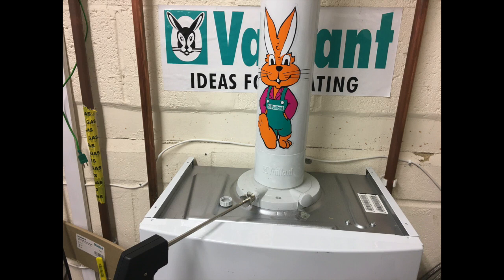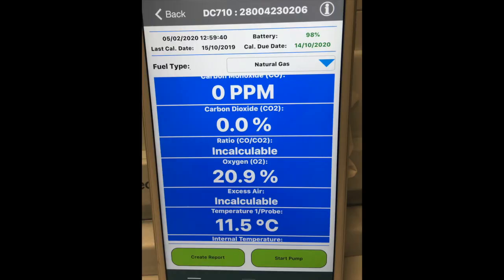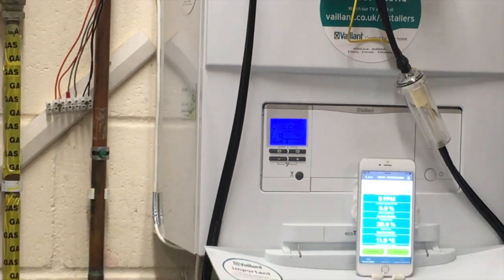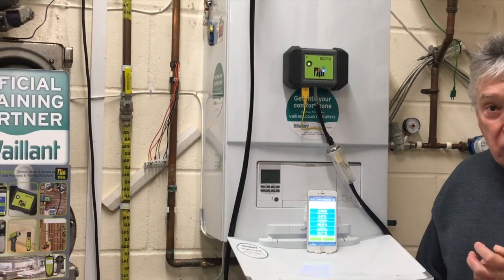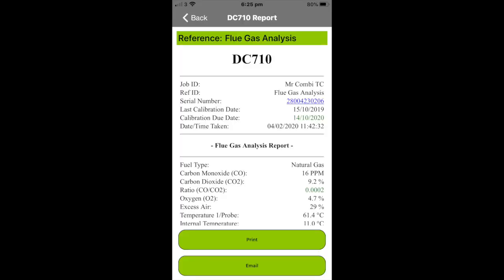We will see these figures gradually changing. What we're looking at is zero parts per million carbon monoxide — nothing at the top moves at all, just the bottom one getting warmer or colder — but it's changing, which means the analyzer is working perfectly. More importantly, the flue is sound; there are no emissions going into the appliance and poisoning the atmosphere. We can create a report, set it, and that's the end of that stage.